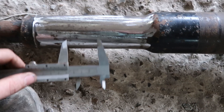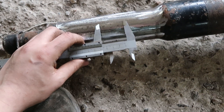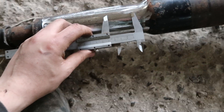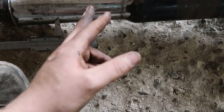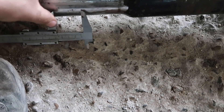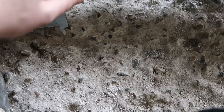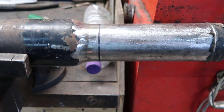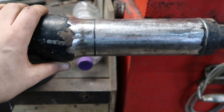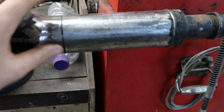This piece is about 350 quid so I don't want to mess it up. On mine I need to chop 39mm. I need to work out where exactly to chop, but basically I'm shortening it by 39mm. The plan is: chop the bit off, slide a steel sleeve over it, weld it, smooth the welds off, slide the sleeve over, and weld the sleeve. Probably wouldn't recommend doing this because prop shafts have to be balanced perfectly, but we've run out of budget so we're doing it the old-fashioned way — got a bit of paper wrapped around it to get the line straight.